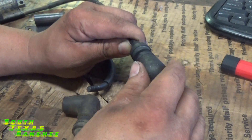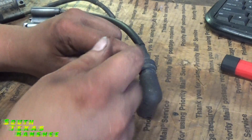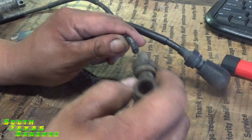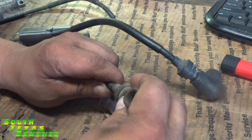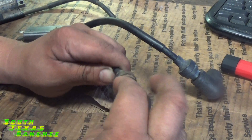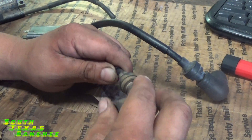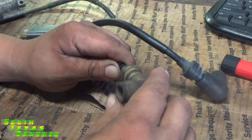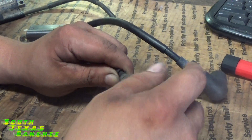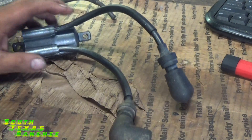It's not going to get tight right away, but you'll start to feel a little bit of resistance as that screw contacts the wire. Right there — that's about as tight as I want to go before I strip it out. Do the same thing with the other one: push it in until you feel that contact, push kind of firmly, twist the first couple of times, then just keep twisting and you'll feel it start getting a little tighter. That's about as tight as you want to go.